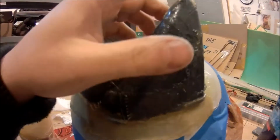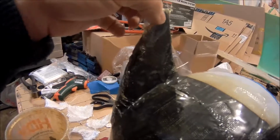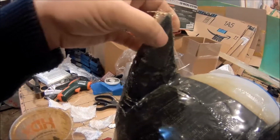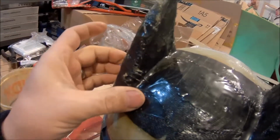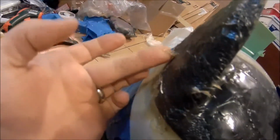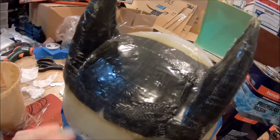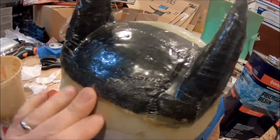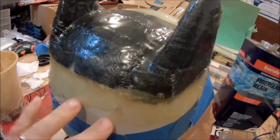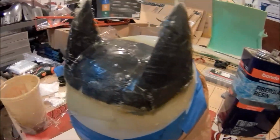But now we're going to take and sand all these little raised edges off. I'm going to cut as much as I can first, and then that'll make my sanding a lot easier, because I mean these are sticking out. So get this roughed down where we got nothing raised, and then I can go back and run the skim of filler over it. Hopefully I won't have to add more than 1, maybe 2 skims of filler, and it'll be sanded and primed.